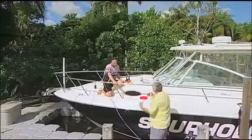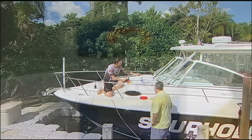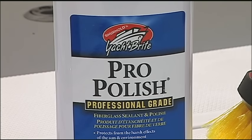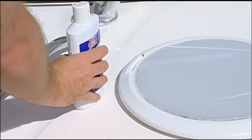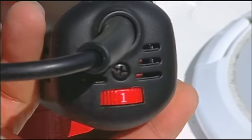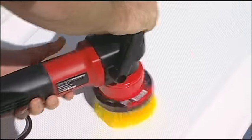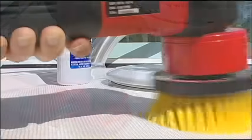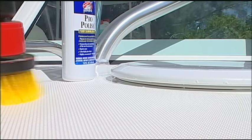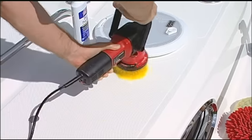Is there a special type of wax that we should be using? Yes, you want to use a liquid polymer based wax like our Pro Polish that I'm using here today. You're going to just lace it down. Because it is a liquid wax it's going to be easy to spread — you couldn't do this with a paste or a hard wax; that'd be tough to get into all the nooks and crannies. You kick the machine on at a nice slow speed like a 2 or a 1, and you're going to do the same exact pattern you would with a buffing pad. With this brush it's going to get into all of the nooks and crannies.